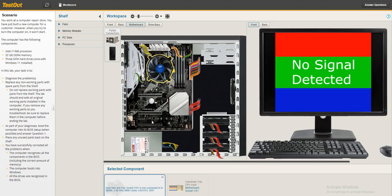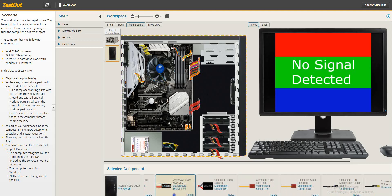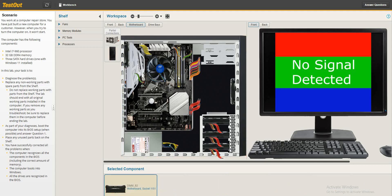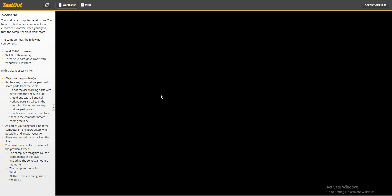Over at the case, the HDD is not connected. We already know where the HDD port is — it's supposed to connect here. We check the RAM slots: slot one, two, three, four — all four RAMs appear to be in place. We go to the front, try to turn it on, and it gives us a black screen and a beeping sound. That is definitely a RAM issue.